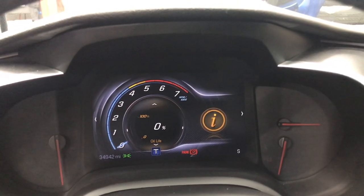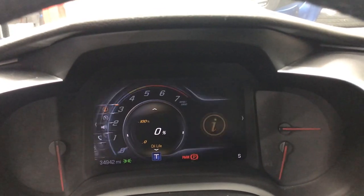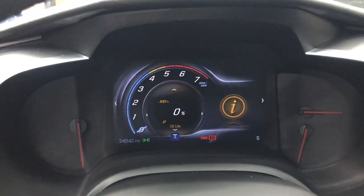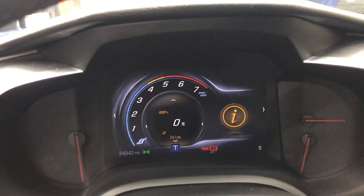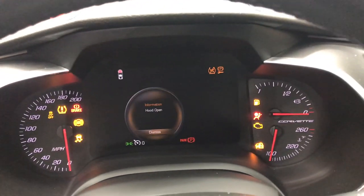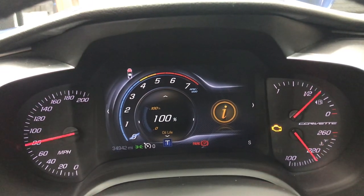Now that we've got the oil changed, the last thing we have to do is reset the oil light. It's really easy. Go ahead and place the car in accessory mode. Scroll down to find the oil light option — it's in your information section, and you can scroll using the controls. Go to that section, hold down the select button, and once you hear that beep your oil light is reset. When you start the car, the life is set completely back to 100%.